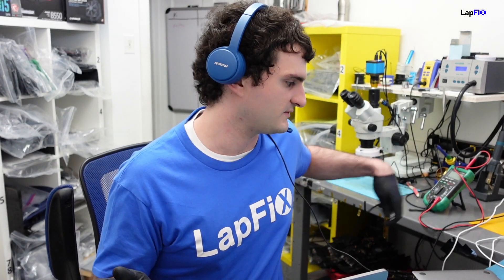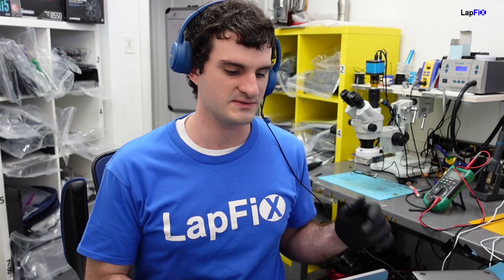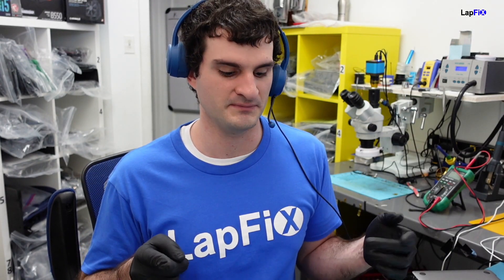It's making a noise because it does realize that a connection is not present. I can see at least the connections are connected. The customer came in after doing a battery replacement and they get that icon — they're worried about maybe a sensor issue or something else going on. It's turning on, which is a good thing. If it's a trackpad or keyboard that isn't connected, that's usually what causes the fan to spin really loud — it means that component is being recognized as disconnected. We're hoping that's just what it is.